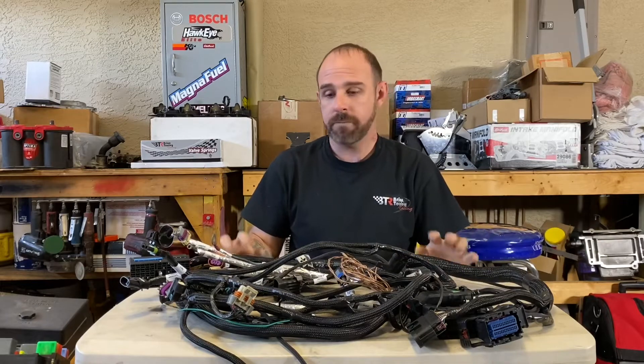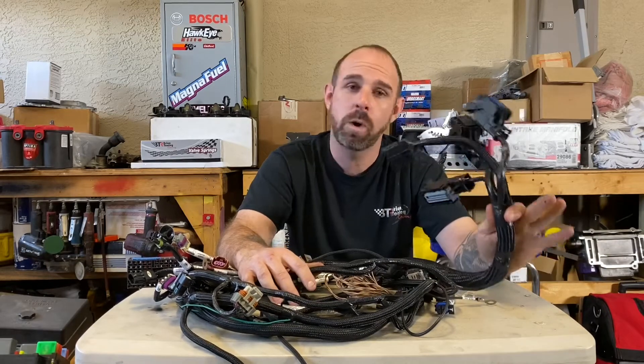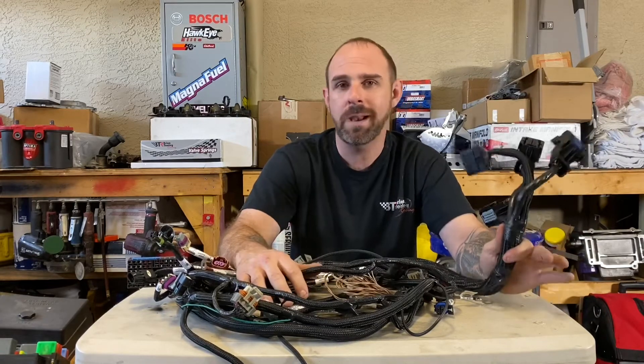They will add or take away anything you want. I had a flex fuel sensor added so I could run E85 — no problem, already pinned into the factory computer. Whatever transmission you're running — 4L60, TH400, whatever — it will be wired into your computer. If you need a separate transmission control module they'll tell you and there'll be a plug for it. They'll ask where you want it mounted — firewall, glove box, under the seat, in the bed — they'll lengthen the harness however you want.